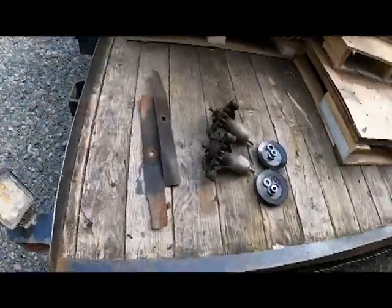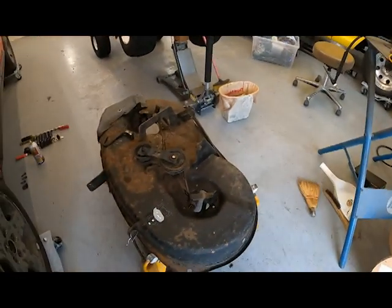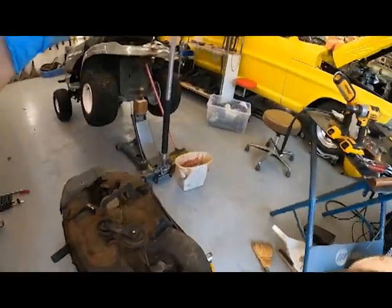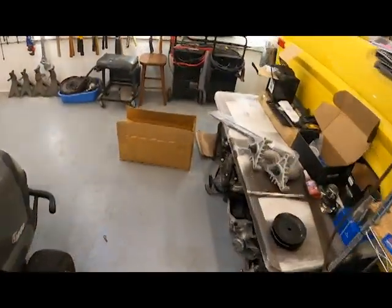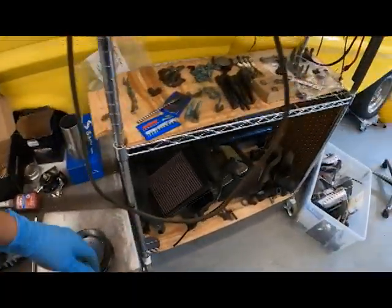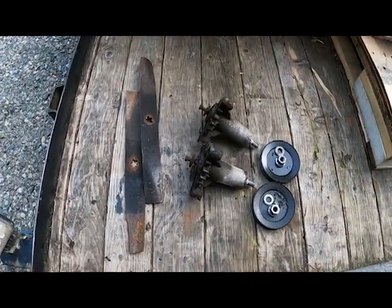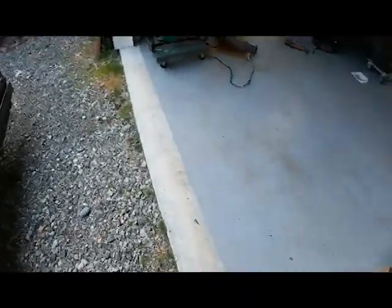These blades are two inches shorter — I think this is a 38-inch deck but I ordered parts for a 42-inch deck. So my blades are too long, and because I ordered for a 42-inch deck, the belt is too long too. They sent me two kits by accident but they're both the same wrong kit. So I'm just going to go to the local store, take my belt and blades, and see if they can get me the right parts.